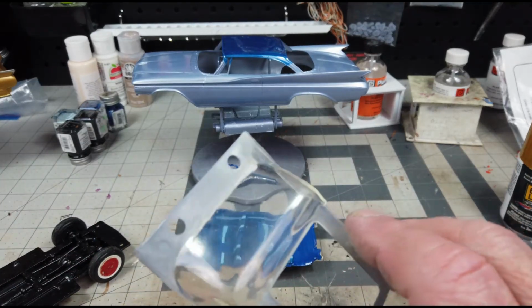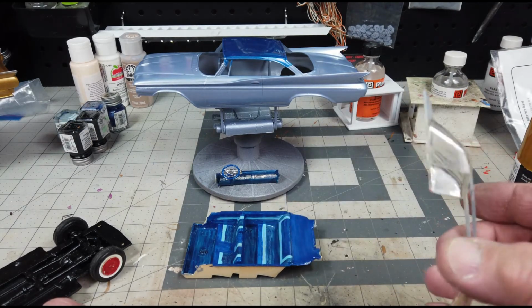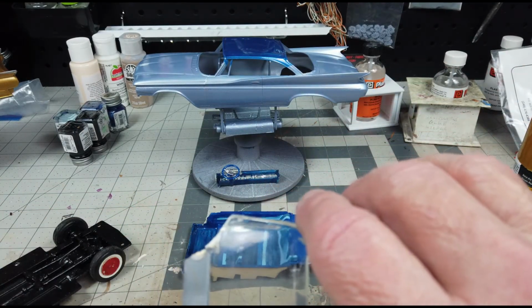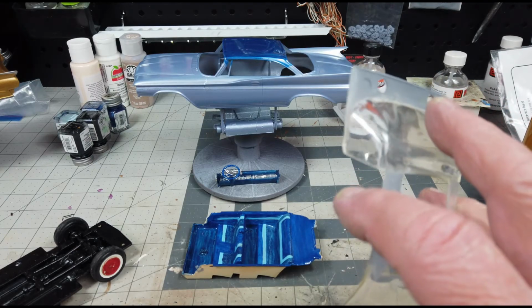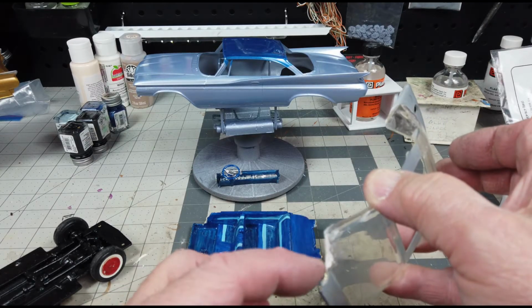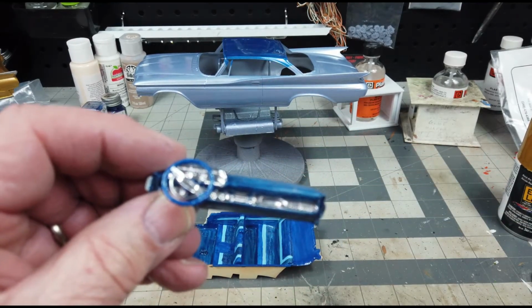windshield. That's actually plastic, but what they call the glass. I've got to work that. That's going to be tough on that one. I did manage to get it loose from the car finally. And a little piece here, they had glued that so solidly to the body that at some point or another, somebody had tried to remove that from the body and ripped a piece of the body out. And I managed to do a nice little cut around there and was able to cut that loose so that I could get that away from the body. I'll show you that in a little bit, what I had to do on the body.